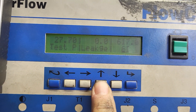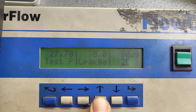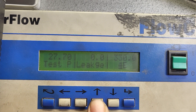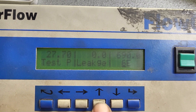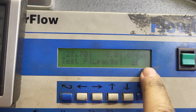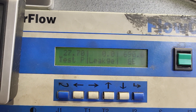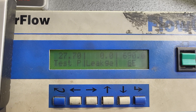Now we're just going to do the intakes — that's what we get on the intakes. We could go through the exhaust as well. If you notice, the exhaust actually flows a touch more — about 690 on the calibration scale. In reality this bench has a real problem getting over 600; it really doesn't like it at all.